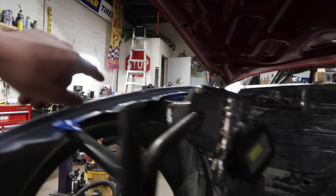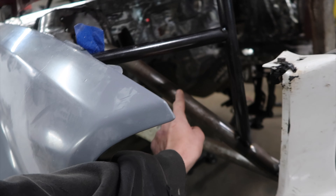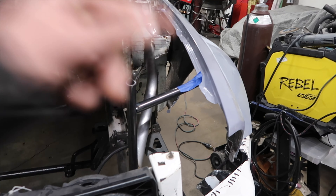But we nailed the tube bends pretty right on the spot. It goes all the way up to that plate in there and then literally the fender sits on it perfectly right there. I think we're going to add either a gusset right here or another inch tube down, and then maybe a big tube that goes right there. But I have to wait till I get my new bumper because this bumper is so screwed up from just constant use all summer, so it doesn't really line up perfectly. The fenders line up really well with the hood though, so that's good. We're going to do a big V that goes down towards the ground - that'll be the jack point in the front - but I'm going to wait till the new bumper comes in next week.